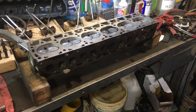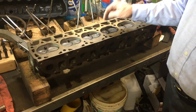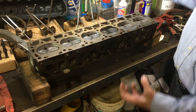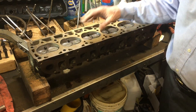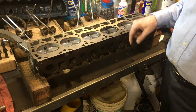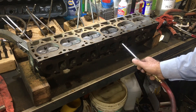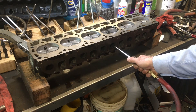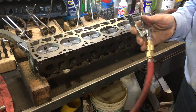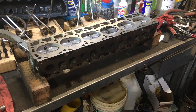We took this one valve apart, and where the air was leaking out, there was a little piece of trash that had fallen down in the valve as we were putting things together. Everything is really clean here, but a little piece of trash got underneath there, and that's exactly where the leak was. So we took it apart, cleaned it, and didn't do anything else. Put it back together — and we don't have a leak. That just goes to show you what a little piece of carbon can do when it gets between a valve seat and a valve.